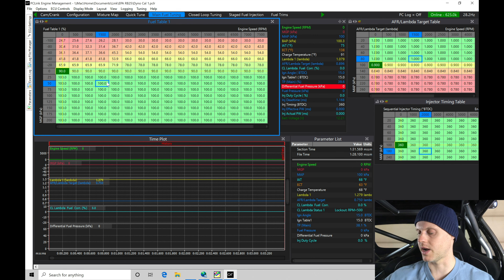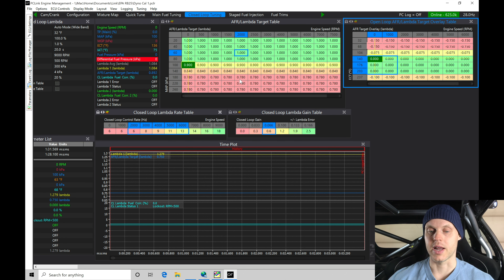Let's go into our main fuel tuning and fire up the motor. The engine is up to 136 degrees, so it needs a moment to warm up — we want it to come up to about 160 to 170 degrees, which is about where we want to run it. Then we're going to start to drive it and evaluate. We have our closed loop tuning on, so it has our target air-fuel ratio active.